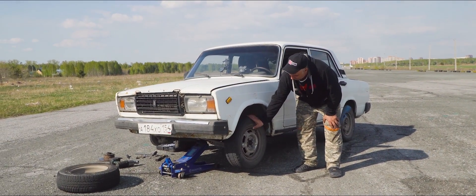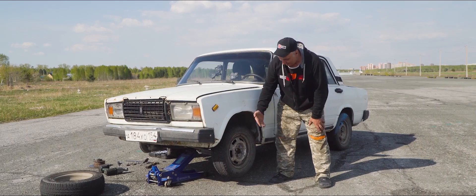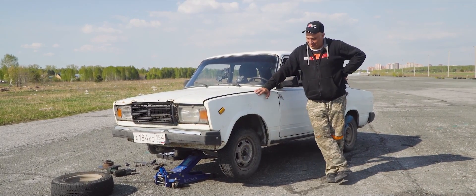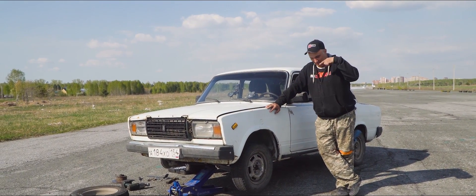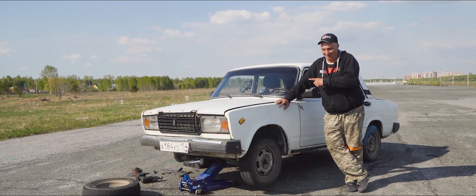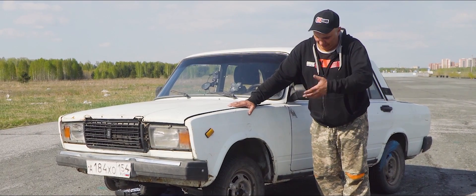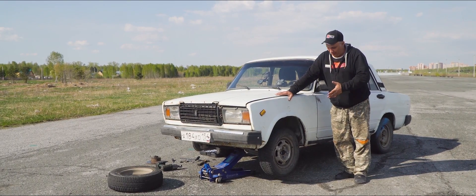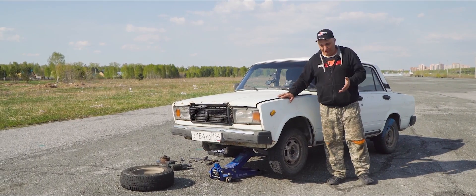In this type of situation, when you're driving without a cap protecting the bearing, it's quite obviously exposed, and you don't have a seal placed on the inside - so you really want that cap to be in place. That said, if you stuff in enough grease, as our experiment proves, you can actually drive around, even with the bearing dirtied on purpose. We don't even have any play in the bearing. The bottom line is that even if you do lose the cap - say, after driving through some mud - no need to panic. You just need to make it to a repair shop, let them dismantle and clean everything, piece it back together, add some fresh grease, and you're free to continue driving.